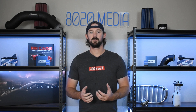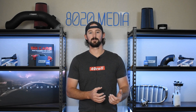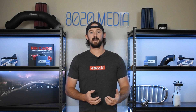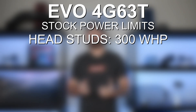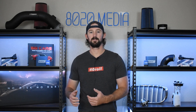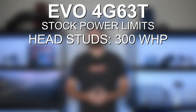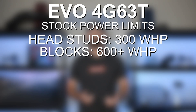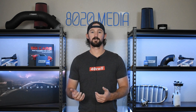The DSMs did not come with fully forged internals like the Evos did, so the Evos are a little bit more power capable in stock form than some of those DSMs that didn't receive forged rods and forged pistons. Talking about Evo power limits, the first thing you're going to want to do is get ARP head studs. As mentioned, anything over 300 wheel horsepower is when you're going to start needing these — you certainly aren't going to want to try to push past 325 or 350 wheel horsepower without them. With just a good set of ARP head studs, we can get to about 500 wheel horsepower before we need to start talking about other considerations. The blocks on these engines are extremely strong — they can easily push 600 wheel horsepower plus in stock form, and fully built they can push 1200 plus wheel horsepower.